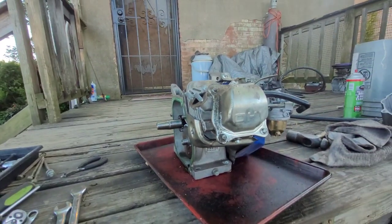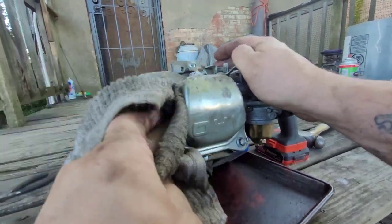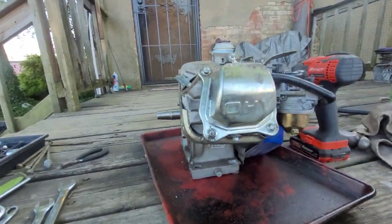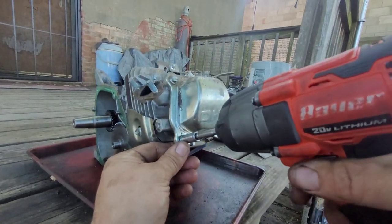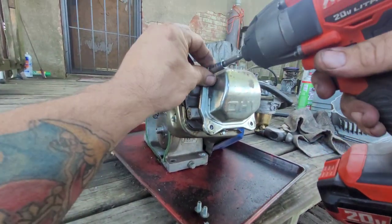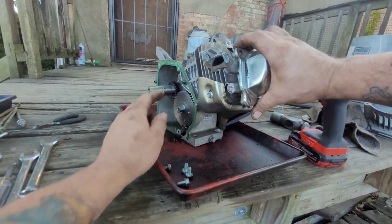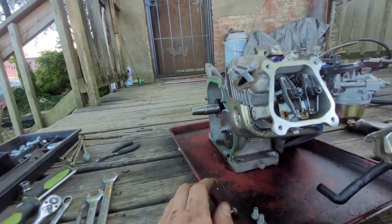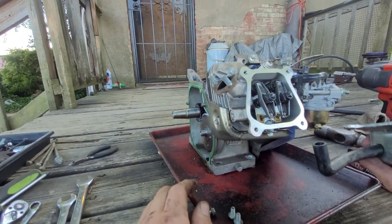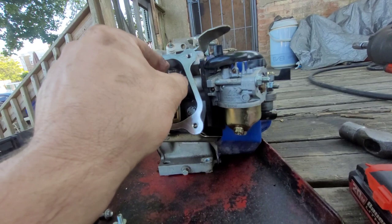Hopefully this don't have some kind of regulated coil so we can use that coil. The Hondas do. Honda coil won't go past 6,500. I do have a flywheel for this, from that blown up motor, it's a 196. I can make a nice little motor out of this. Oh, I got Mod 2 cams laying around. I could put a Mod 2 in this. I have some Champion rockers I could throw in this. Some 26-pound springs I could just throw in this. It sounds good.